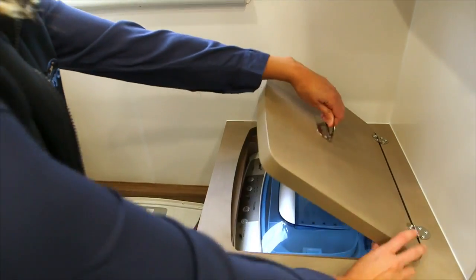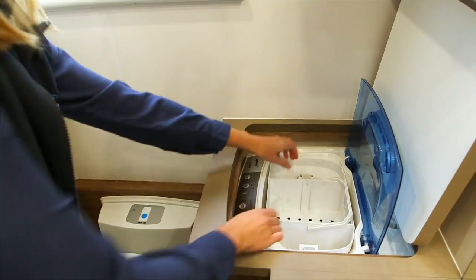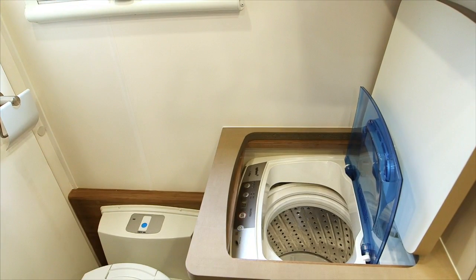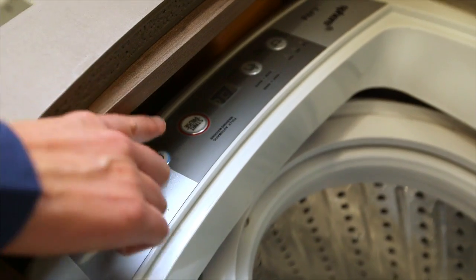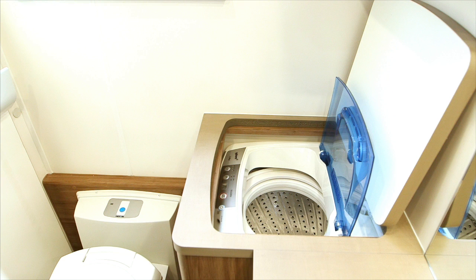The Sphere 3kg washing machine has 5 programs, from a wash-rinse-spin cycle lasting approximately 38 minutes to a simple spin cycle lasting approximately 7 minutes. Wash settings are set via the control panel. To wash clothes, select the proper water level according to the quantity of clothes, select the program and process, close the lid and press the start/pause button. For more information, refer to your washing machine operation manual.